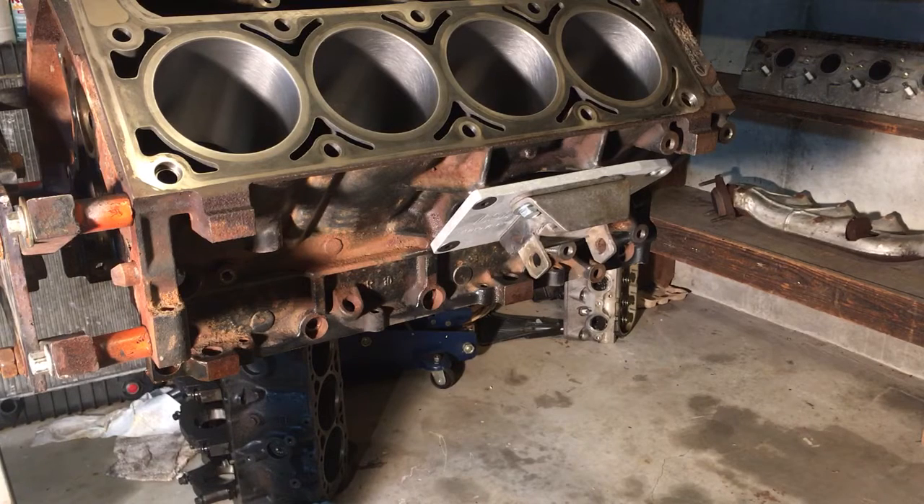You can buy the single stock-location LSX Innovations plate for $20 shipped to your door, or for $30 you get four different installation positions. Since I'm not sure where this engine is going to sit in relation to the firewall in that S10 Blazer, I opted for the adjustable version so I can make sure I have plenty of clearance to the firewall, clearance for my front accessories and dual cooling fans, and enough room to run all my charge piping for the turbo.